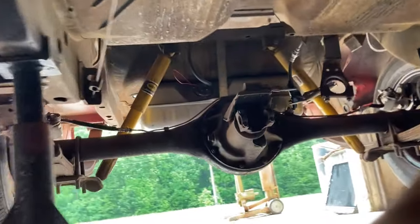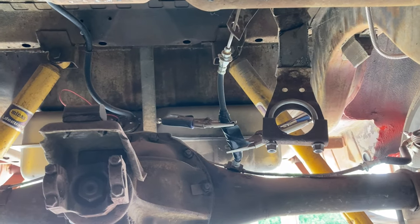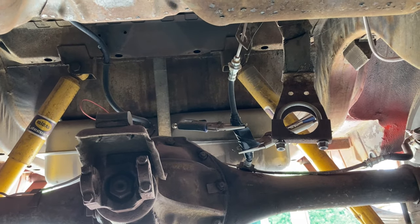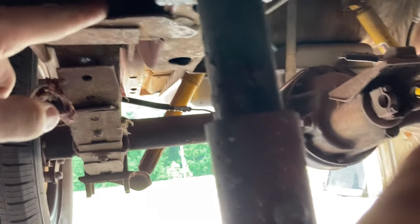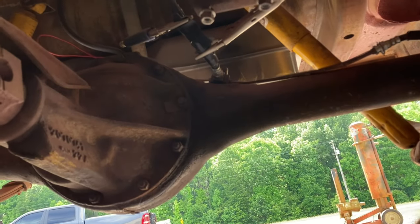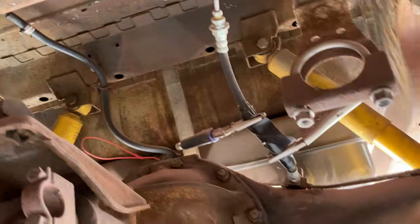Getting the rear end out and fuel tank — the tank looks fairly new. A lot of the gas that came out of it — I got new shocks too. See the old Midas Lifeguard there, that's kind of funny. The old gas that was coming out going to the engine was pretty brown and rusty, and I think a lot of that was the old fuel line. So I'll go ahead and pull it, flush it, just to be sure there's not big stuff hanging around in there. Not much to pulling these rear ends — these four bolts. Drive shaft's already out. You can see the Texas line locks here for the brakes, so I'm just going to bust it loose here and get the shocks loose and roll the rear end out. I may go ahead and do the gas tank first — it'll be a little more open in the back to get to those shock bolts.